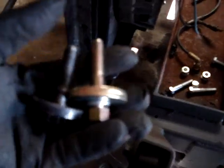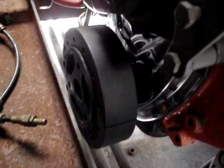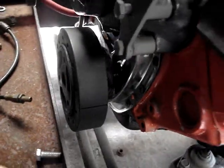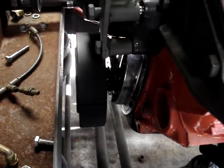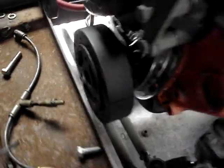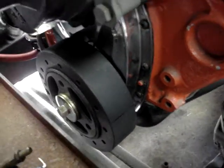I should have done it before I even put the engine in, but I need to get the harmonic balancer on. It's close, but I left enough room. I got a new bolt. You just got to watch the seal, that it doesn't fold over — usually that's because you didn't put any grease on it. The grease slid right on, no problems.